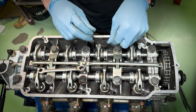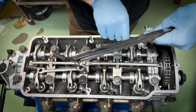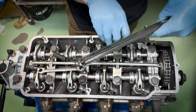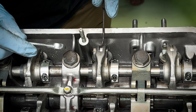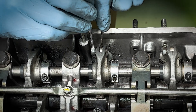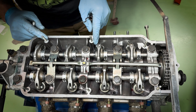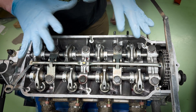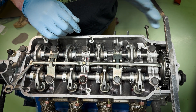It's a little hard to get in and out. Then what I'll do is grab my 7, and this one should just slide right in - which it does, with barely any friction whatsoever. It just goes right in. So I'm going to lock it down. I like to hold it - this is why I bent the tool the way I did, because I can push it and hold it up against the valve cover seal area, and then just tighten it. Make sure it's nice and snug - there are new lock washers on here to make sure it doesn't come undone. Number 2 intake is done.